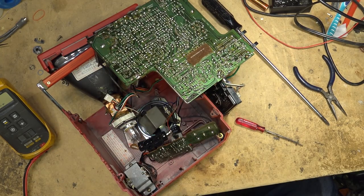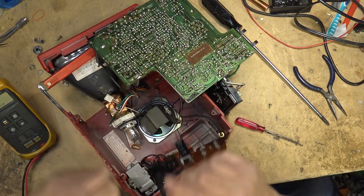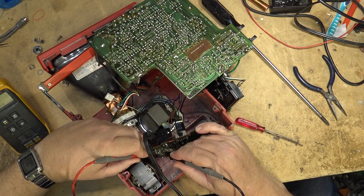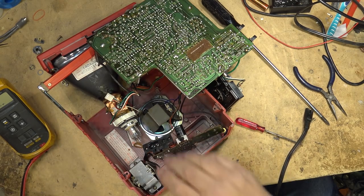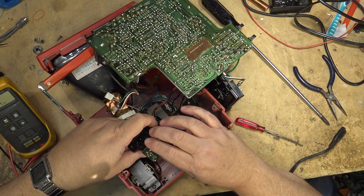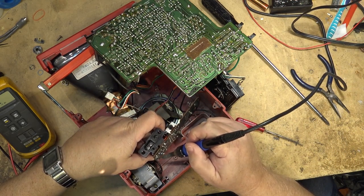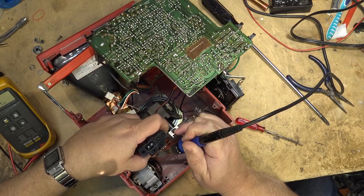When I plug in the power cord, will it activate the switch? Let's see. Yeah, so the switch is being activated — it was on the DC side before, now it's on the AC side. Let's pop this fuse out and see what I've got to replace it with. It looks like a 1-amp fuse. I should be able to find a 1-amp fuse around here. It's a soldered-in fuse — called a pigtail fuse. So let me just take the old one out and find a new one.